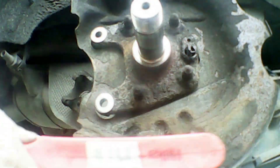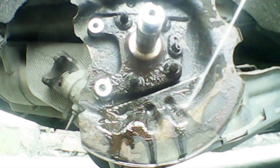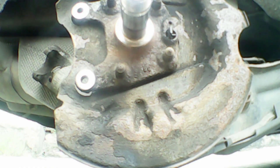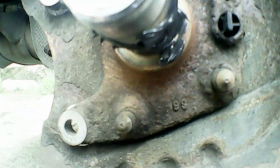The disc comes off nice and easily. Now we're going to clean up behind it — there's the ABS sensor, so be careful with your wire brush. Just give it a nice good clean and wipe down, then blast it with some brake cleaner. Using the wire brush helps remove any contaminants, especially around the ABS sensor, and makes it easier when you put the grease on. I'm going to use a bit of CV grease and just lube up the shaft on the axle. CV grease is the best thing for this — it doesn't really interfere with the bearing inside the new brake disc, because the rear wheel bearing comes inside the brake disc on these.